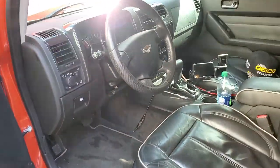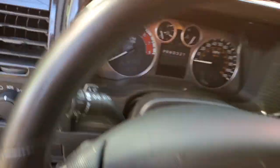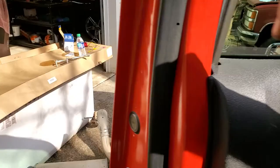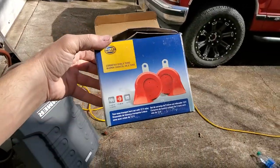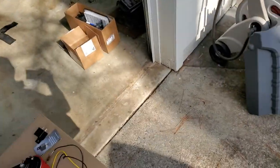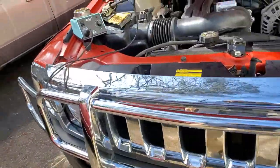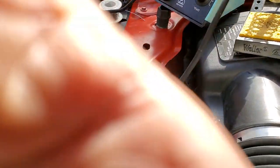The one I added is the higher-pitched Hella horn that comes with that twin set. I'm not sure of the exact decibel level, but that set is not expensive. Much better — much, much better. I only used one of them; I'm sure I'll use the other one for something else at some point. But like I said, any horn you want to put on it — motorcycle horn, another car horn, anything. Just patch into the existing wiring and there's your mounting point. So simple.